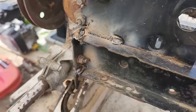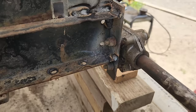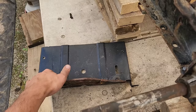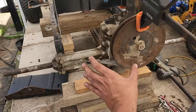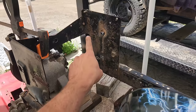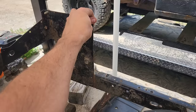There we go - that's all blocked up and put in there. We got this side all welded in, and I set in some weld up across here to gusset that just a little bit. Once everything is all settled in, the one problem is we cut this piece out and this is what makes the rigid part across the back. I think once all is said and done I may make a piece that drops down and comes across straight in here to shore up the rear. I'm also debating whether inside of this rail I should put a cross member welded in right here.